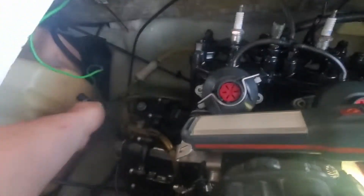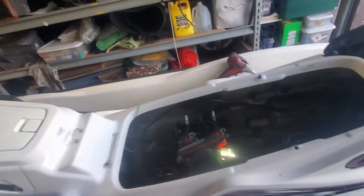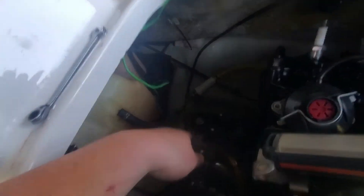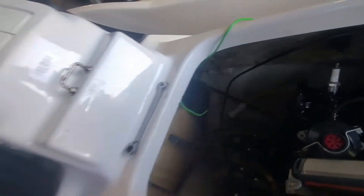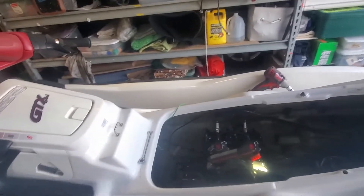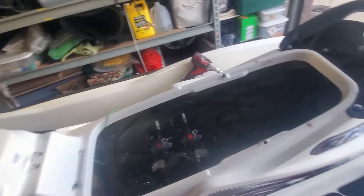We'll get that hooked up, and then we have our line here that goes to the bottom of the exhaust, which will be a pain to get in. We'll do the exhaust and get that clamped up. Then we'll pull that tank out a little bit so we can get our baffle in, get all the gas lines ran, get our oil tank in. We'll probably do that before hooking up the exhaust because on these 951s, this oil filter is buried underneath the pipe and it's hard to get to. Not very smart on Sea-Doo's part, because it makes replacing that oil filter a pain. So I'll get that done before the exhaust pipe goes on.